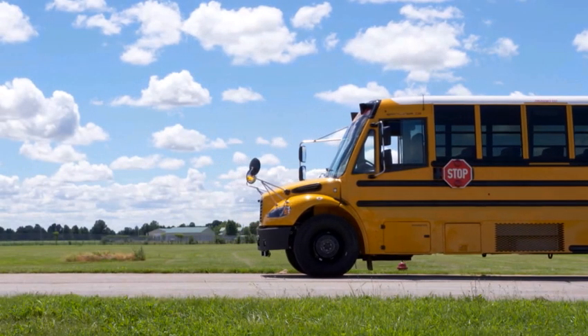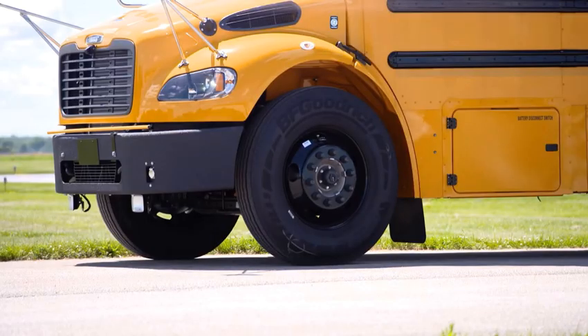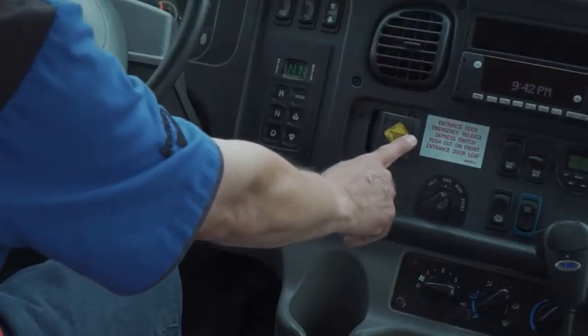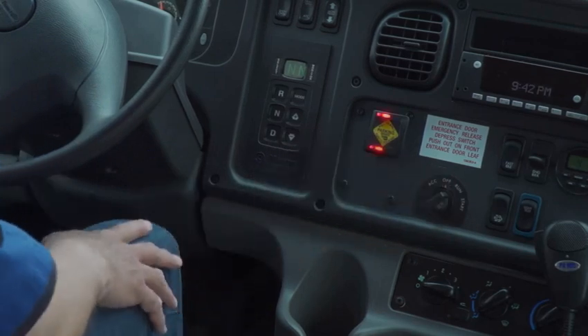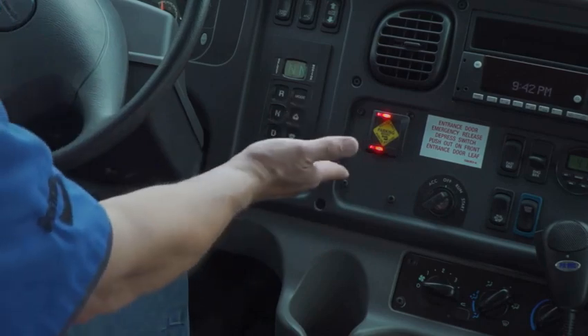The interlocks are also important in helping to mitigate roll-away and runaway collision situations. Let's suppose I haven't set my parking brake, the vehicle is stationary, and my foot's off the accelerator. If I take my foot off the brake, you'll see the Intellipark will automatically engage after 30 seconds. It blinks to let me know that I didn't set the parking brake as I should have. When Intellipark sets the brake, it won't let me release the brake even if my ignition is on and my foot is on the brake, until I set the parking brake manually as I should have.